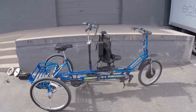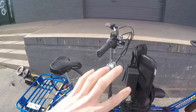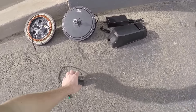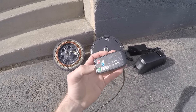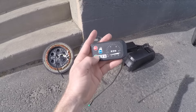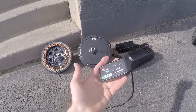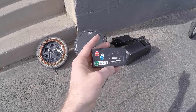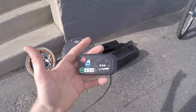These are the five-star levers from Wuxing — they work, they're four fingers wide, decent size, and these ones actually have a parking brake built in. There's just so much you can do with this. Before I get into the display, I want to showcase this LED display because I actually think it's pretty nice. Sometimes you forfeit speed readout when you have an LED display console. On this one it says low, medium, or high — that's your assist level — you just press the mode button. They have four dots for how full the battery is, which are 25% increments. The speedometer is also LED — five, 15, 25, 33 miles per hour. This kit can take you up to 30 miles per hour, though by default it's set to 20.